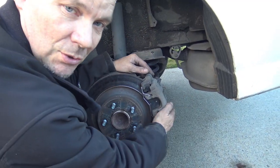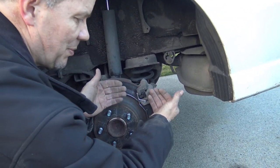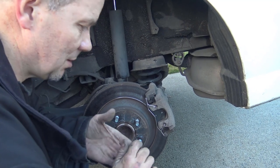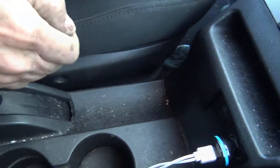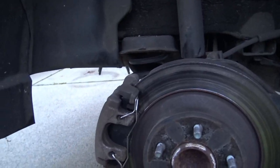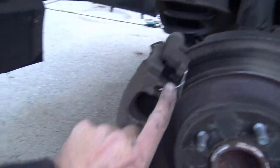I tightened the two rear bolts on the back of the caliper and everything's ready to go. But it's important to pump the brakes a few times just to set the pads, move the piston tight, and keep the pads tight to the disc. Also pull the emergency brake a few times — that should take up any slack in the system for when you first get driving this vehicle. The brake job is just about done. Thanks to Liam I got done pretty quickly, and I did the other side very fast because now I know what to do. Make sure you tighten up the caliper bolts to the proper foot pounds — I'll list that below in the description. Make sure your wire retainer is on and your pads are in properly.